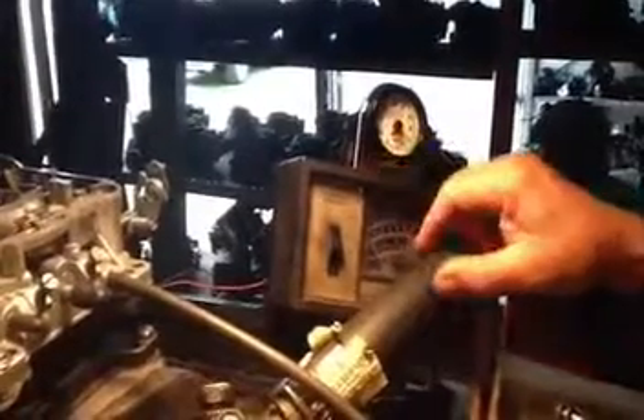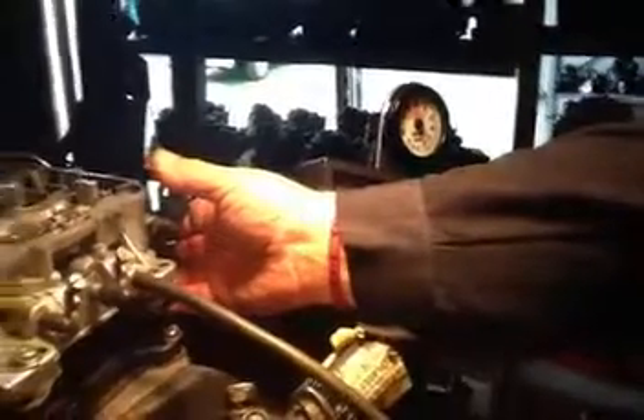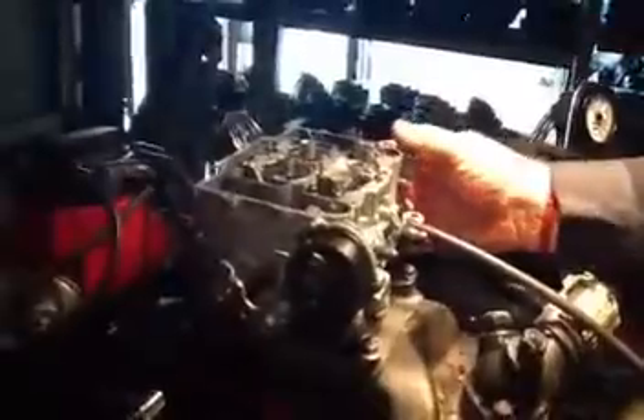Now it's running. Watch the fuel ratio gauge — as soon as that light starts calibrating, it'll calibrate. When that red light goes out, it'll read about 12, meaning the carburetor is running at about 12 parts of air to one part of gas. As you can see, it's revving right up, no problem — running at about 2400 RPM, just like driving down the road.